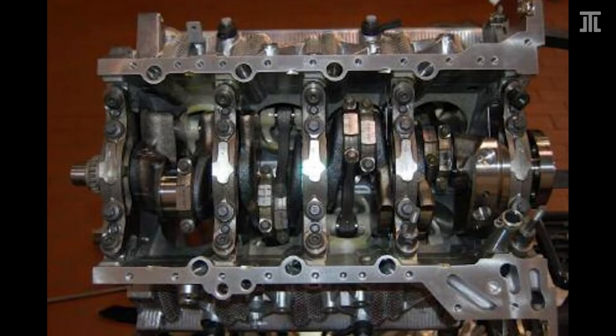The original N63 has an alusil crankcase with double main bearing bolting and additional sidewall bolting. The main bearings measure 65 millimeters in diameter, a reduction from 70 millimeters in the N62.